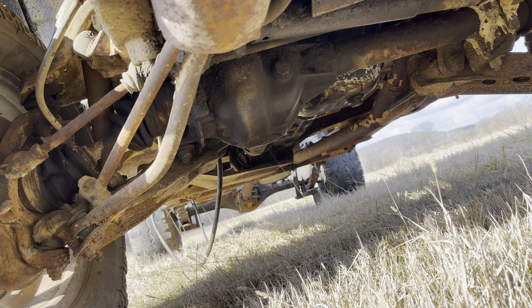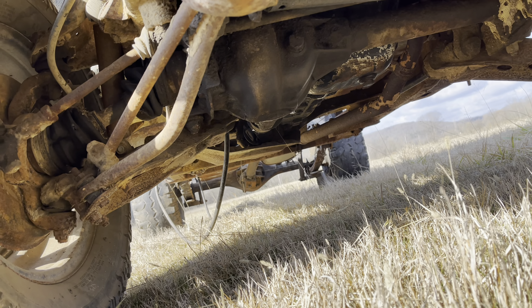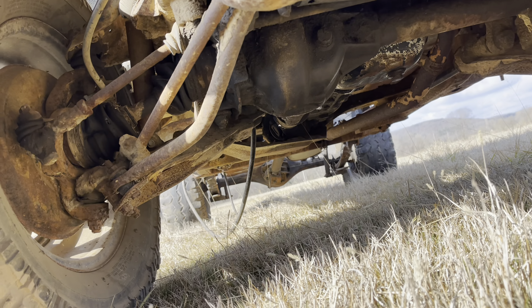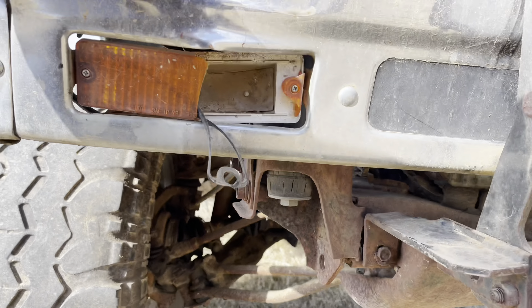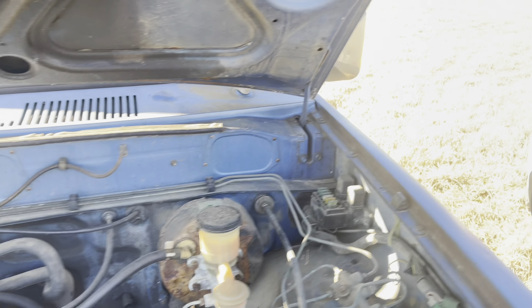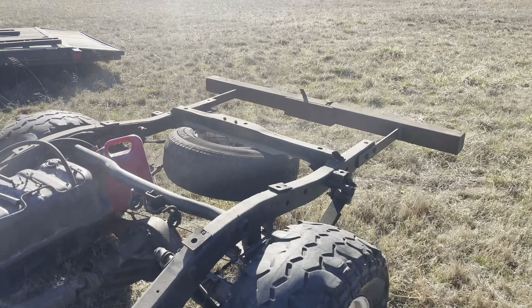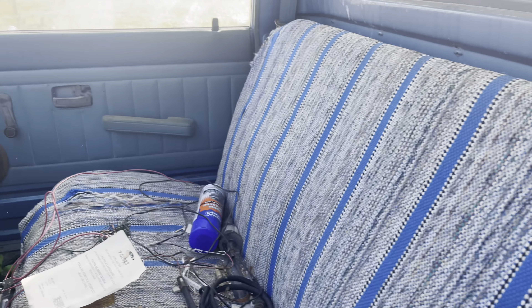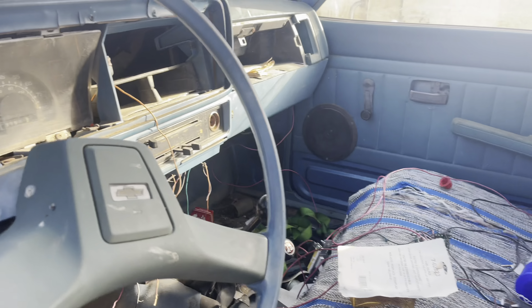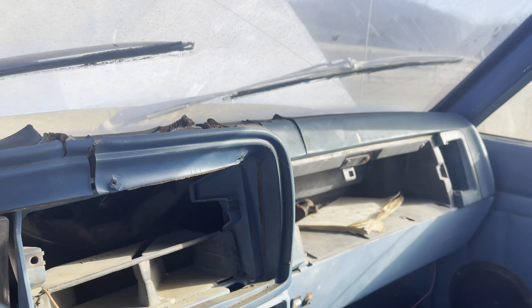This one's going to need some ball joints and tie rod ends and everything. It's got a good amount of ground clearance for such a little truck. We'll just run through it, tighten everything back up, and replace anything that's worn too bad. We might even convert it to power steering since we will be running in the woods. We'll see what the clutch feels like.